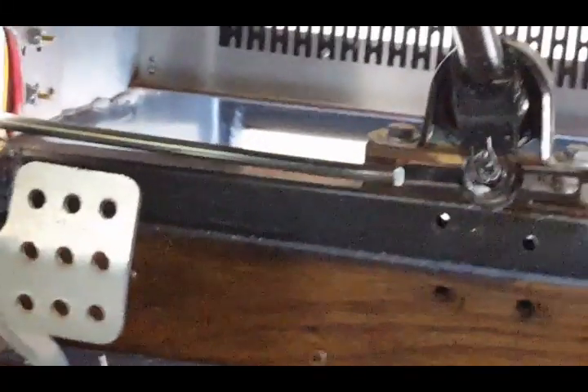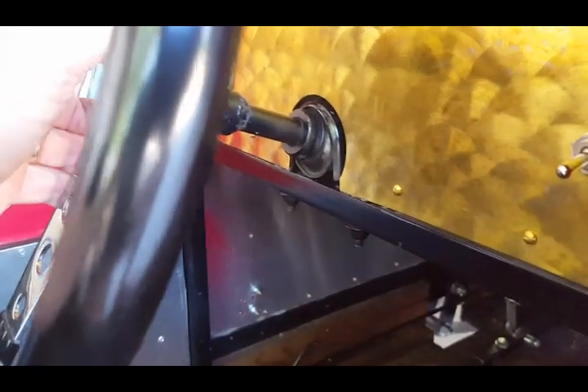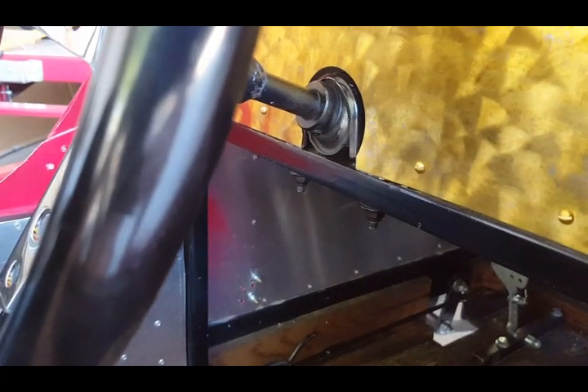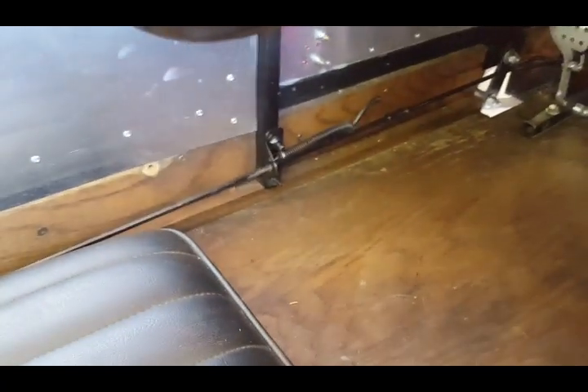You can see the pitman arms there — that's a pillow block for a swamp cooler, about six bucks at Ace. I was trying to find something that would take the play out of the steering system but also be turnable. This works pretty good. I've had guys use a piece of plate steel with a drilled hole, but it tends to get sloppy over time. This has been almost three years of use and it's holding up really well. If they fail, two bolts can replace it pretty simply. There's a bushing in there and collars on both sides to keep the steering shaft from going back and forth. The next thing is to drop the floor to get the center of gravity lower — we've had some occasions where I've been on two wheels, which is scary.